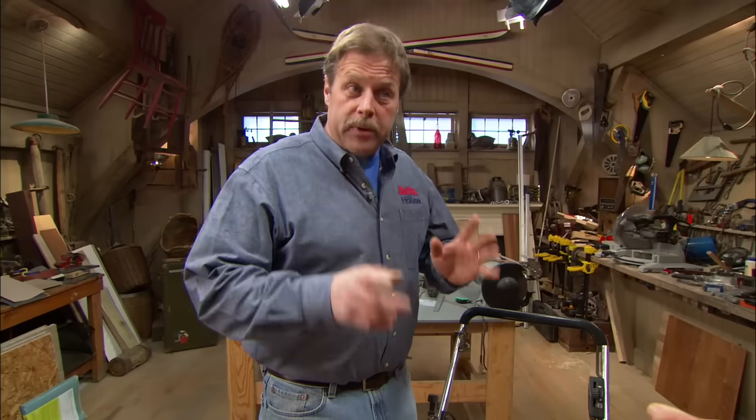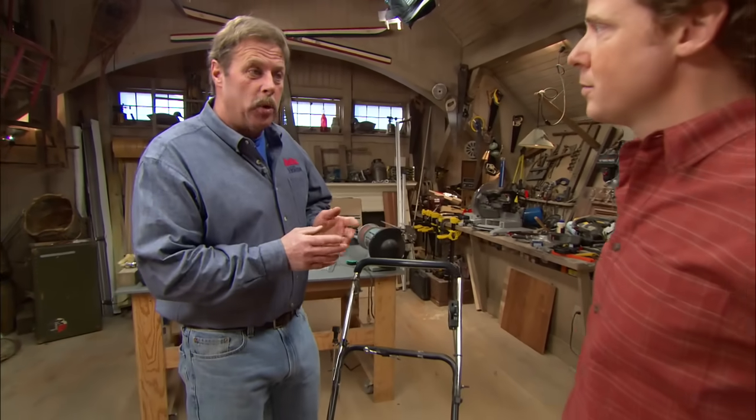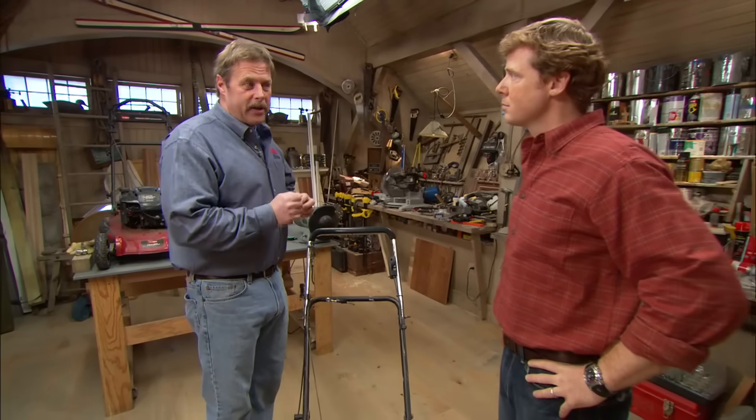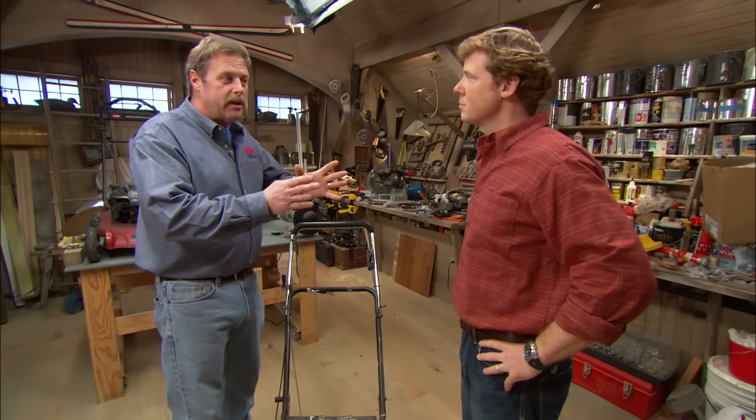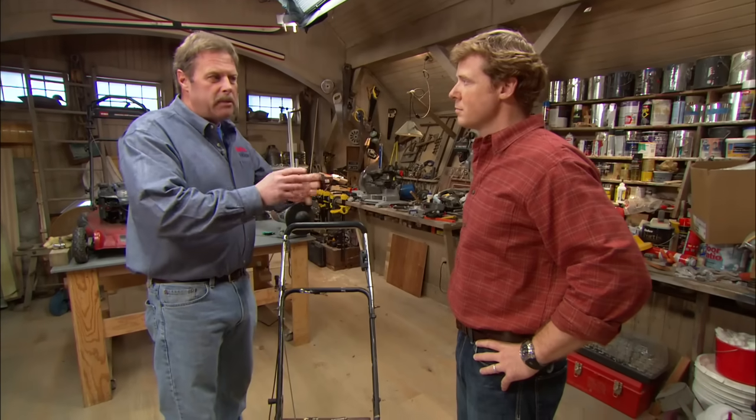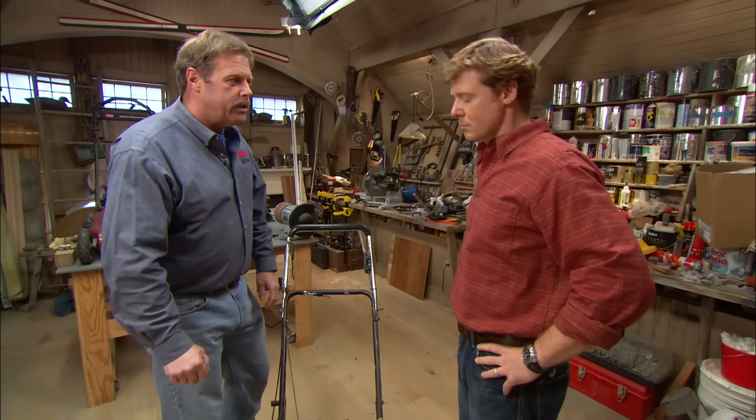And how often am I likely to have to sharpen every season? I want you to sharpen right before the first cut. That's the most important thing. After that, it depends on how good you are with a mower. If you hit a rock, you've got to sharpen it right away. Usually, if you don't, 2 or 3 times during the growing season, you're good.